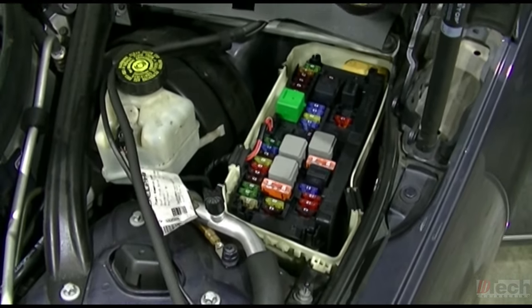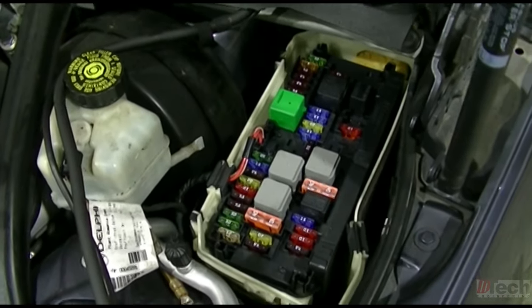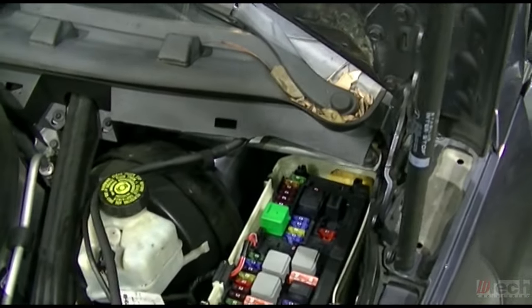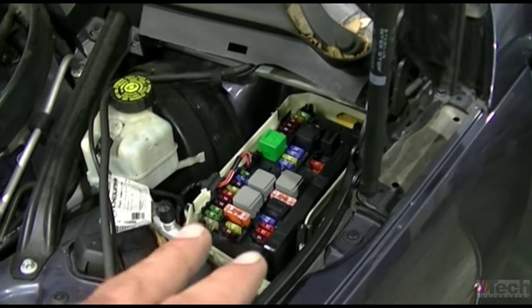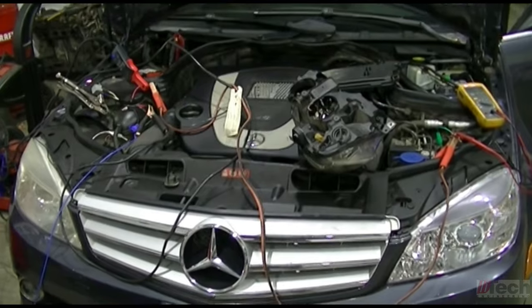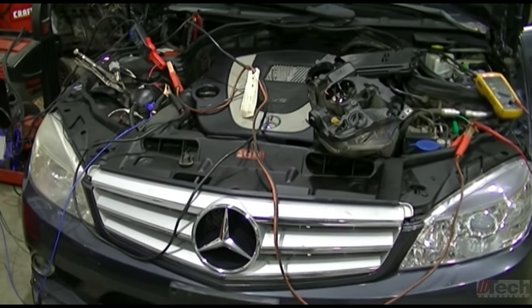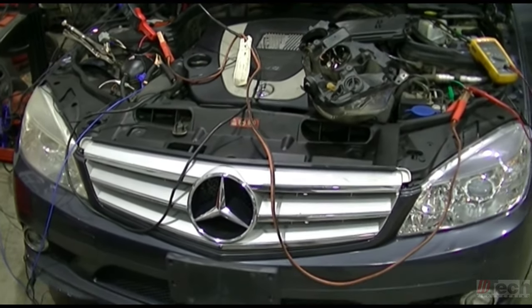Again, I am just going based off experience of the wires touching, the B+ shorted trouble code, and the inability to provide power. Again, I'm calling this a bad module. Because of the situation that I'm in, I've actually called Mercedes, and the local dealer told me that it is a part that is no longer available or produced from them.